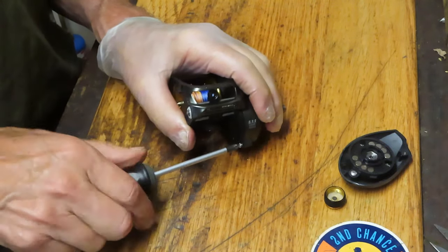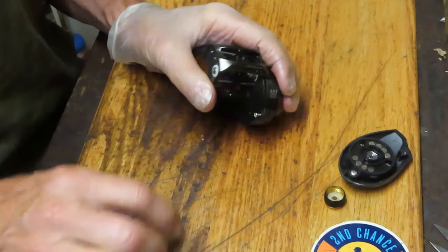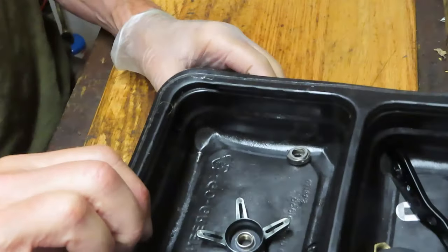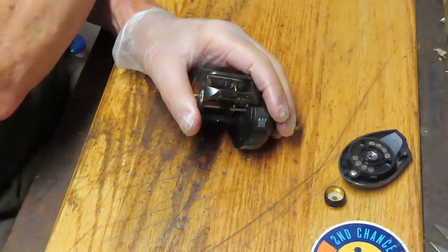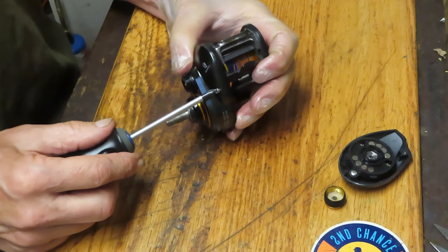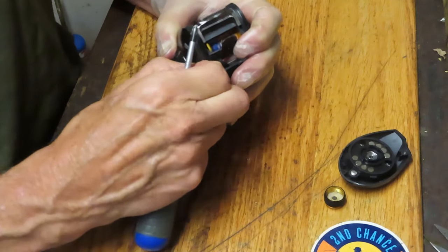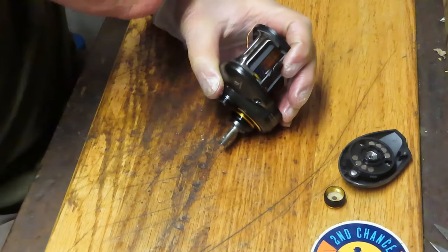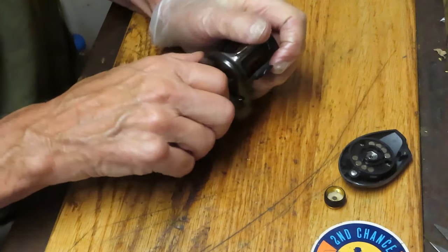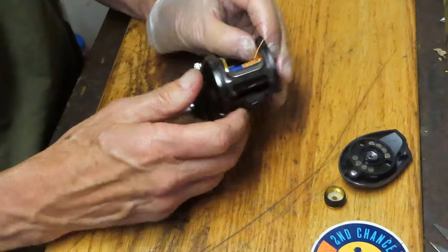Again, take your pictures. That's very important in terms of being able to reinstall. And then when I take my pieces and parts off, they go into a parts tray. The parts tray helps me keep the parts separated, but also keeps me in line with where they are when I go to reinstall so that I don't lose them. And I take these screws off and make sure that those screws are all the same size. If not, I try to identify the ones that may be out.